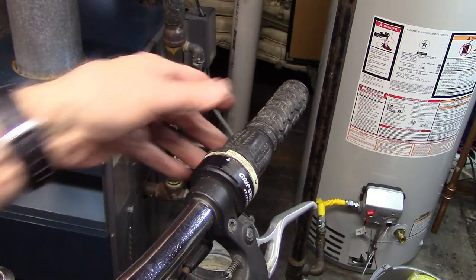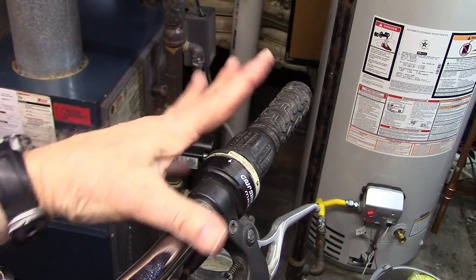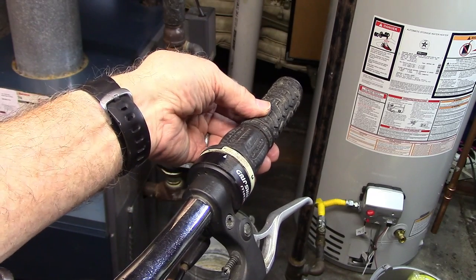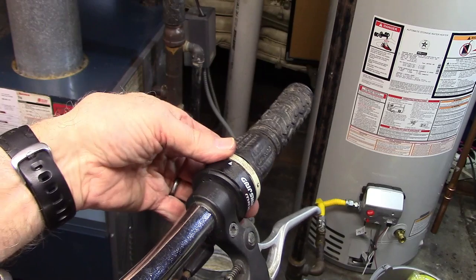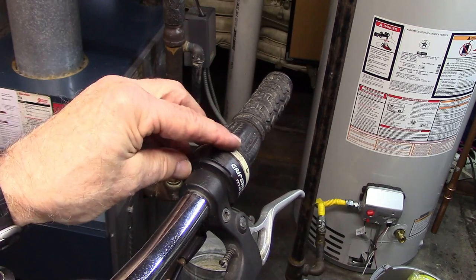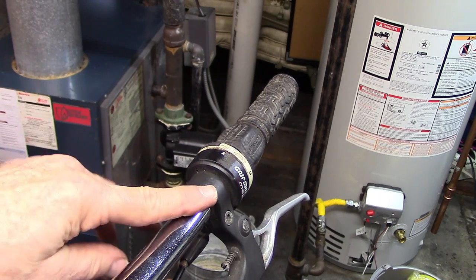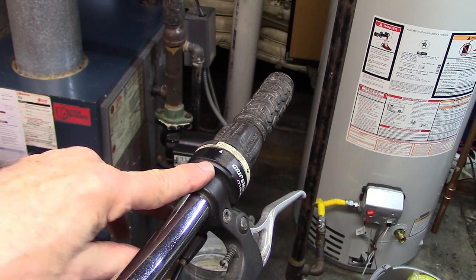On the front derailleur, we'll shift to the number one position and go through the same process of pulling off the handlebar grip, taking apart the grip shift, replacing the housing and cable just as we did previously, although the final adjustments to the front derailleur will be different.